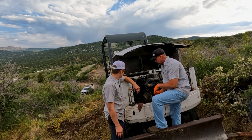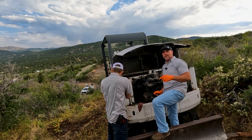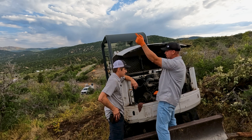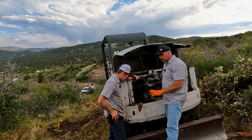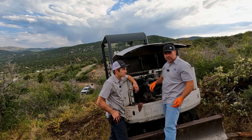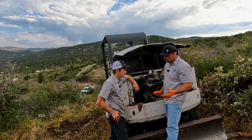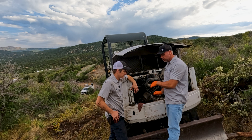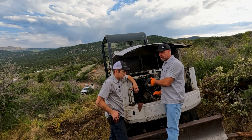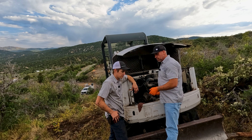What Mike and I are working on today is a Bobcat 341, and they never break down in the most convenient spot. You can see our truck way down there. We lost all hydraulic functions instantly. When we lose all hydraulic functions on one of these older machines and lose blade control, we know we probably have a problem with a pump or the pump coupler itself.